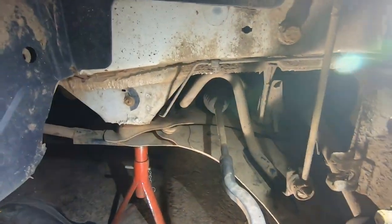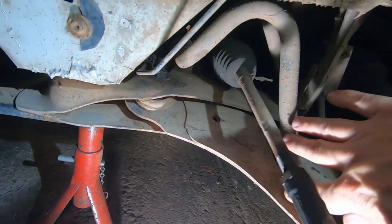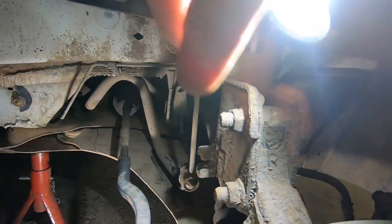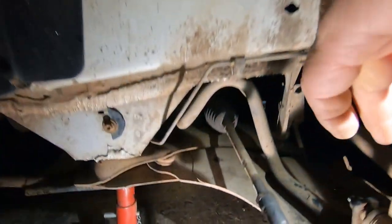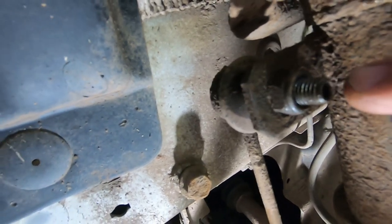Welcome to the under arch of the Vivaro. So, obviously this is the suspension arm, control arm, lower wishbone, whatever you want to call it, that we've got to take out. What I'll start with is I'll take out the drop link, which is a 17 mil nut there, and a 17 mil nut on the back of there. I think it says 16 in behind there. If not, some of them have got a sort of Allen keyhole there, but they tend to round out. So I'm gonna go for the 16 on the back.